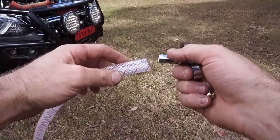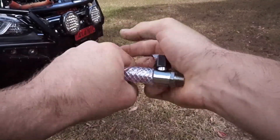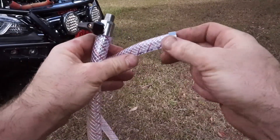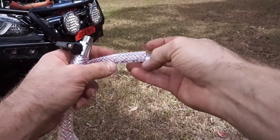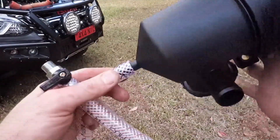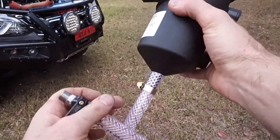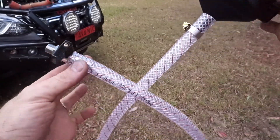To set up the drain hose, I push the barb fitting into the clear hose, push it right up, then put a hose clamp over it to tighten it down. I'll also have another hose clamp which goes onto the bottom fitting of the ProVent catch can. Now I can take the clear drain hose, pop it onto the bottom of the catch can, push it right up, put the hose clamp on up here and also on the drain valve, and then it's ready to fit to the vehicle.